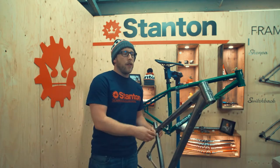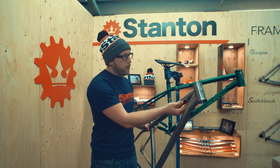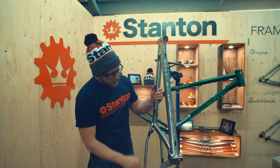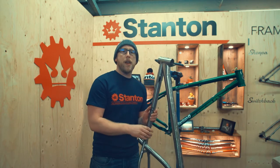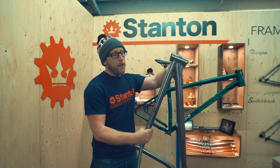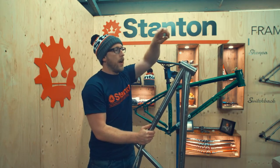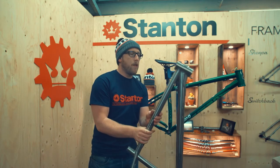There are also a few added extras on the titanium frames. One is the internal top tube routing — it goes in here, out here, into here, and out here, and you can also silence the cabling on this tube. The way the English run it, we run into this side and in through this side, which means there's a crossing in the tube so the cables lay over the top of each other, which stops rattling.